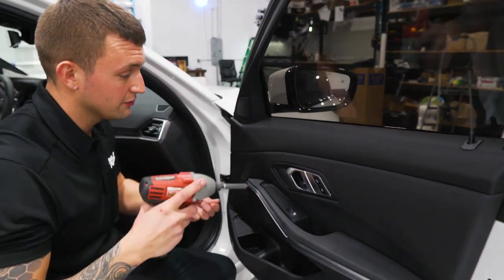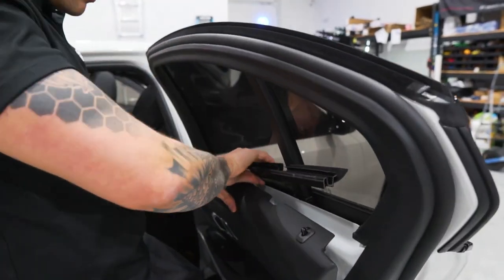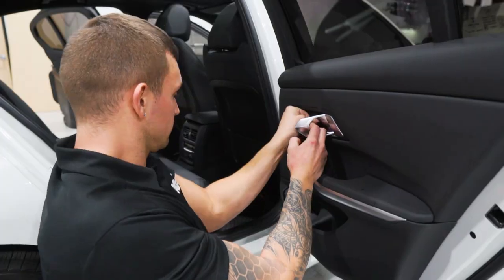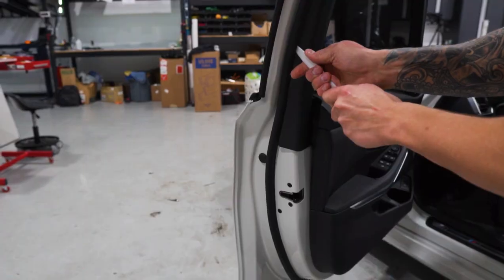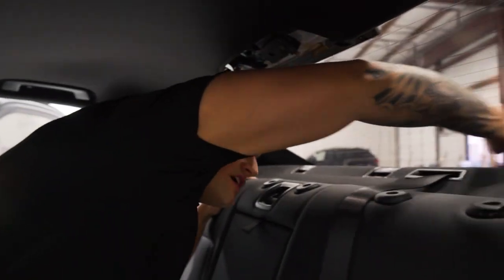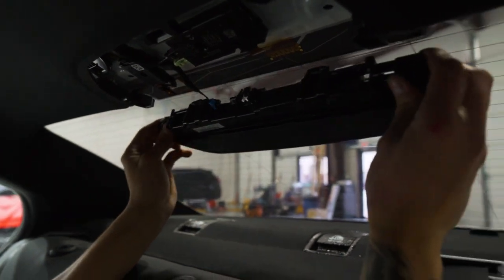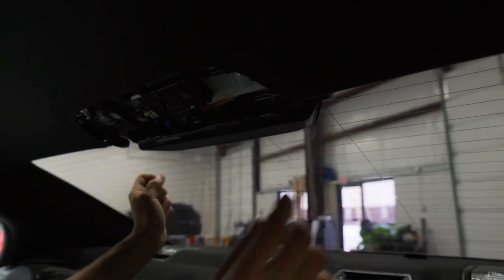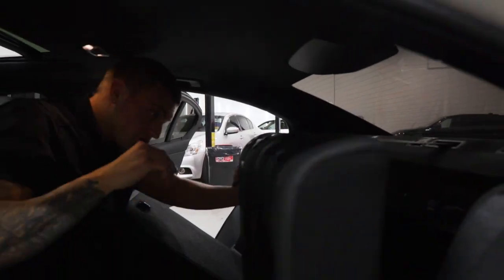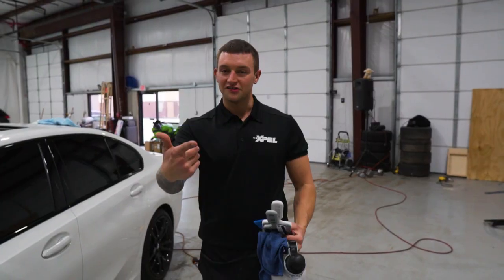After the gasket is in, the back trim and panel back on, put the screws back in and the cover back on top of the screw behind the door lever. Once the back window is done, check for water bubbles and push out any extra water. Pop the brake light back in by plugging it in first, lining it up with the outside clips extended, and popping them in. The cover goes on with the back going in first, then pops up. Grab the headrests — no hook tool required to reinsert them. Quick wipe down, and that's it. See you in the next video — enjoy the process.